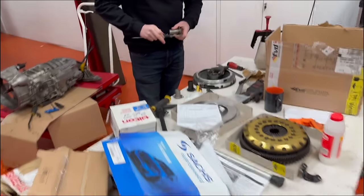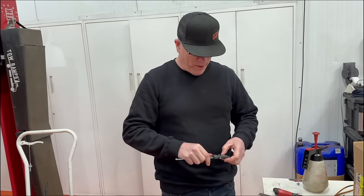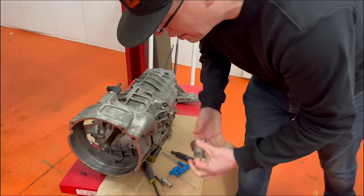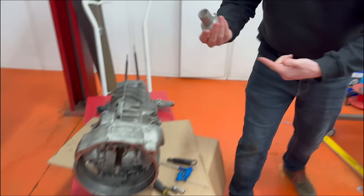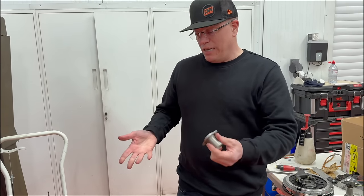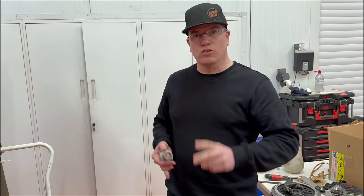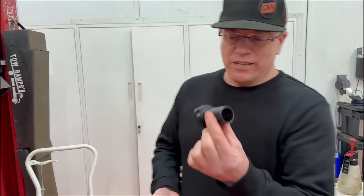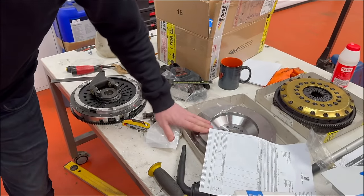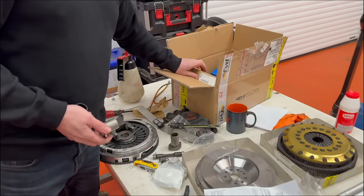There's been a little pause in proceedings because Phil's come out and possibly saved a mess. This is what was bolted to this — part of a load of bits Phil bought last week to put this back to stock clutch mechanism. They're basically all 964 turbo parts. The problem is that these are 964 turbo parts, and that is a dual mass flywheel. That piece is too short — this is the one for the RS flywheel, the single mass flywheel, which is not what we're using because that wasn't right for this car either.